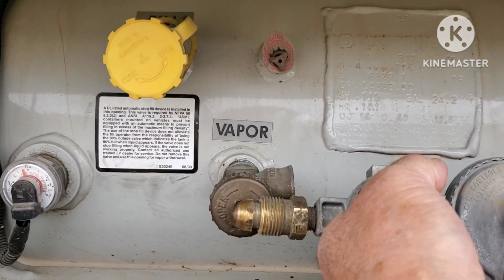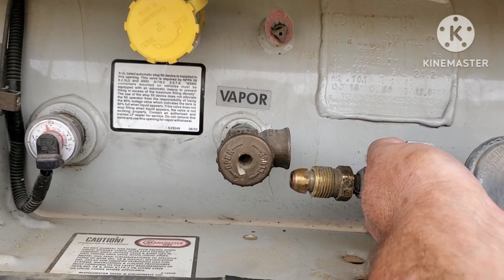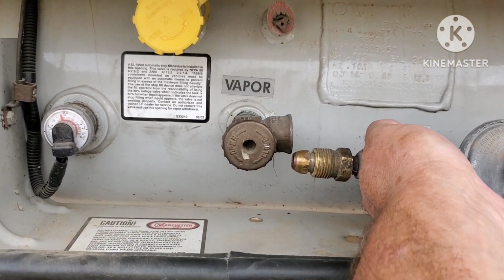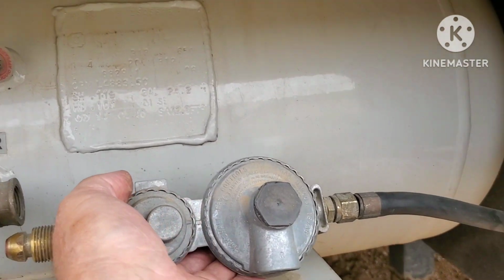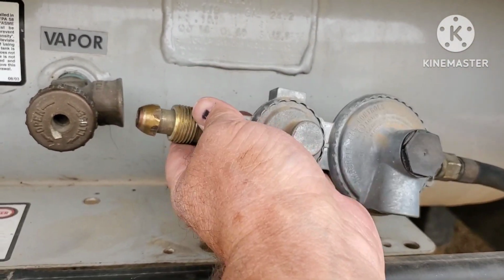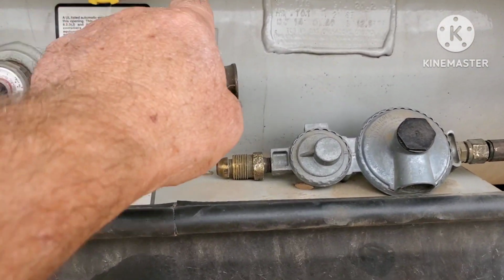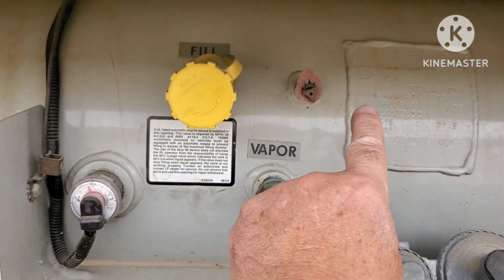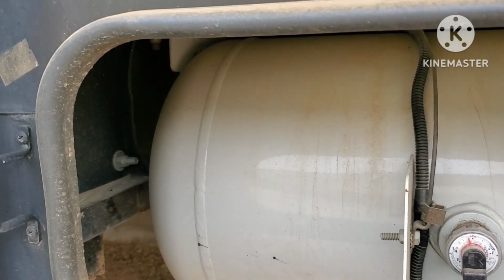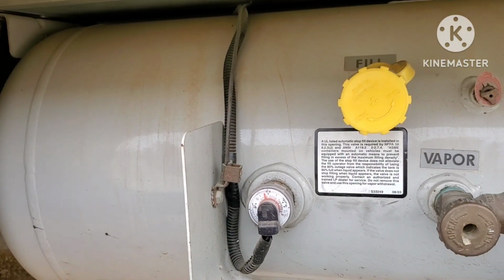pipe. Oh, there goes my air conditioner, so hopefully that won't interfere with the video too much. Into the straight pipe that goes into the rest of the steel hard line, and I couldn't get it off here. It doesn't swivel, so this is the next swivel union, so this is where it all came apart. And then it's disconnected on the back side of the tank where the line goes back, and then it goes up, and then it goes through the floor all the way to the other side. So I disconnected that. I got it to move a little.